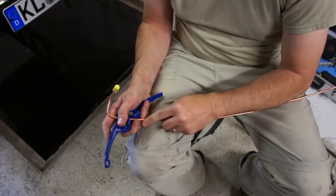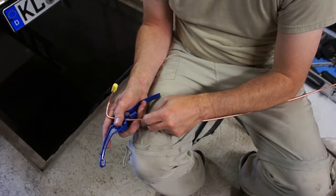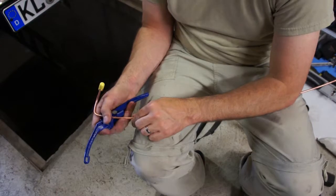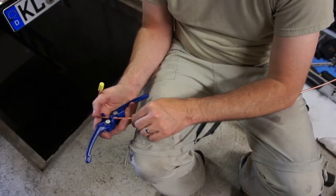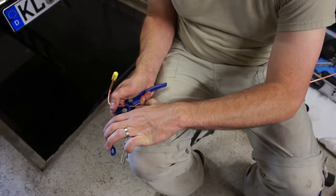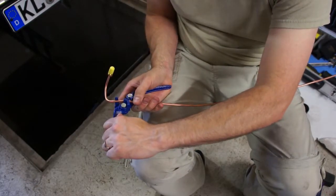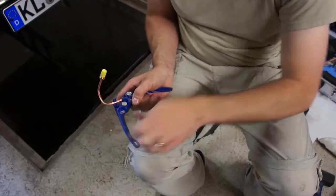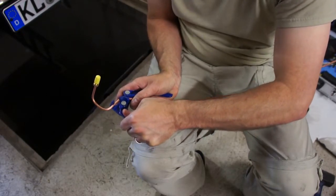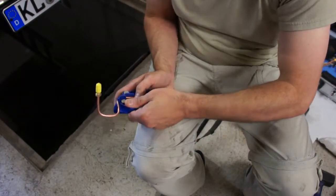I need to also get the length right, because there's not as much room here to twist and then come down along the front of the heater core. So basically right about that much, and then you need to start twisting - it'll bend right at the edge of the tool. Start bending, come nice and slow. You don't have to go fast with the tool; you don't want to crimp it. There we go.